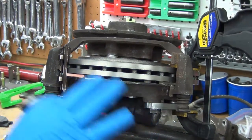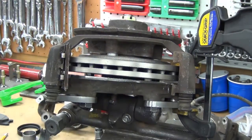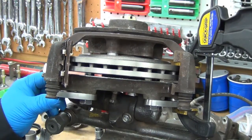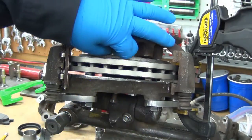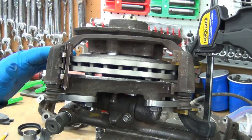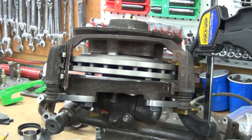At least for today I think I have a final answer on the dual piston bracket, which is this mount right here and this setup. I was looking at it yesterday and figured out that I can make it work by using the 720 caliper and putting 180 thou of spacer in between the hub and the rotor. Obviously it's not going to be washers — it's going to be a plasma or CNC plate cut out of 3/16 plate.